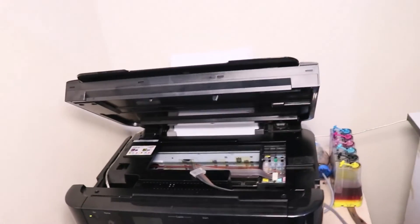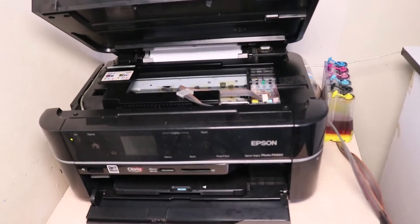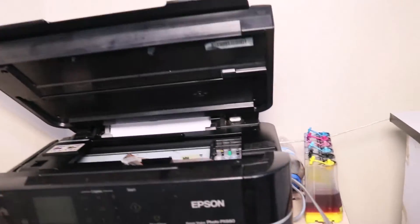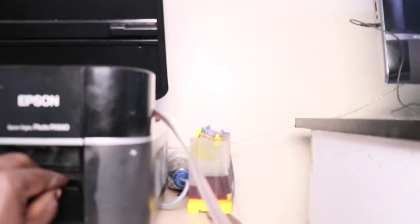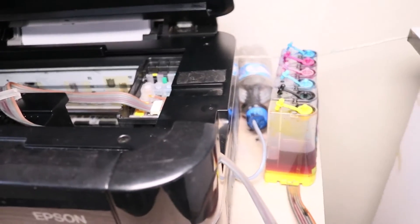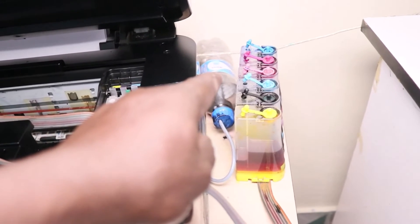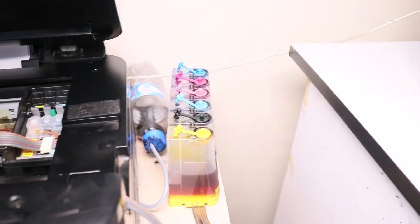When the technician came and tried to power the printer — there is a power connection behind the printer — it shorted the power supply. What the technician did was remove the ink container that was inside and told me it was no longer useful. He modified this section of the printer and made a hole at the back, where the pipe releasing the waste ink now connects to a water bottle that I'm using as the external tank where the waste ink will be emptied.